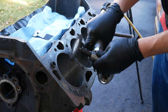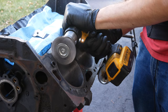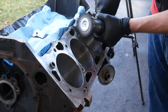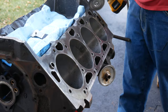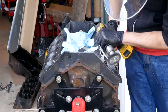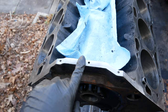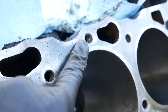We got to use that for about 60 seconds before the air compressor decided it wanted to be a drama queen and trip breakers. So we'll use the backup rotary tool which is this much abused DeWalt drill. It's not as fast as the die grinder and it's a bit more unwieldy but it will also get the job done. I'm not applying a huge amount of downward pressure — we're mostly just trying to set the brush on the surface — and doing this it took about 15 minutes to get this side of the block to shine. Then we joyously get to repeat the process on the other side. Soon enough the deck surface was looking pretty nice. That took a lot longer than I had planned, but got it done and the deck surfaces as well as the rails are clean and totally smooth.